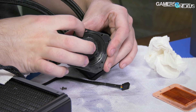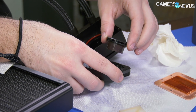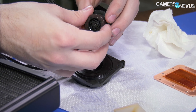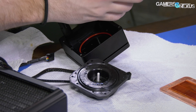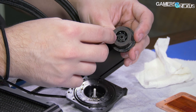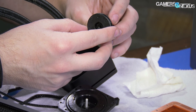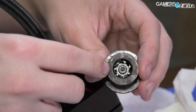Against the o-ring you can see it's bracing on this bit of the housing, the plastic shell around the impeller. It's magnetic, polarized as all pumps are. You pull it off and there is the impeller, which actually looks pretty similar to stuff that Dynatron makes. I'm not sure who Enermax's supplier is for this — maybe Dynatron, but I'm not positive. Pretty similar to the old Dynatron stuff from the Antec 1250. There are grooves on the outside where you can see basically the blades — you can see where it's pulling and pushing the liquid.